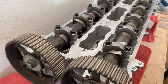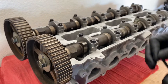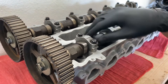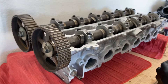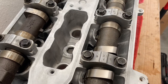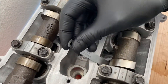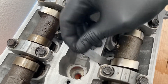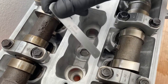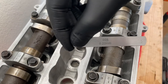If you need to adjust for thickness or get a smaller shim, you'll know by how much because you already have the clearances written down. This first one is good — eight thousandths of an inch. Moving on to the second lobe, it's already in position. I'll start with eleven thousandths just to make sure — that does not fit. Going down to ten — that does not fit either. Nine fits but I have to push it, so I'll try eight. That one's perfect with minimal effort, so this is the same reading as the first: eight thousandths of an inch. Well within spec.